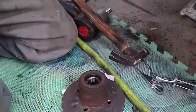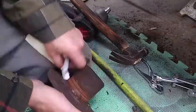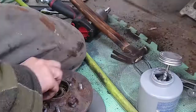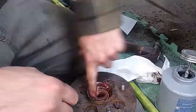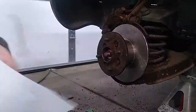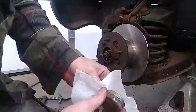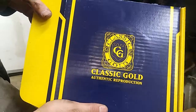I cleaned up the rust on the hub before attaching the new disc. I also applied some never-seize on the threads and on the mating surfaces, so hopefully this won't be a problem again for anyone who comes back in here. Assembly is the reverse of disassembly, except the new pads were installed last, which is how I wanted to take them off but it didn't work out that way, followed by the pad retaining spring and pins.